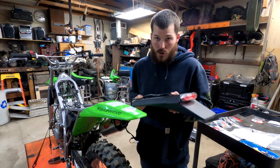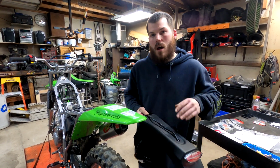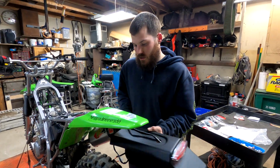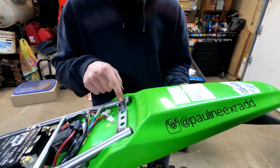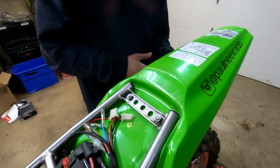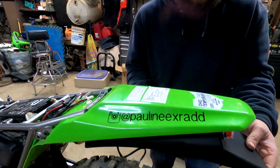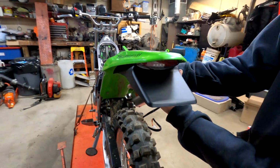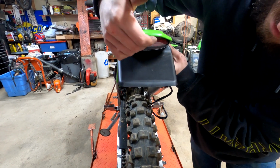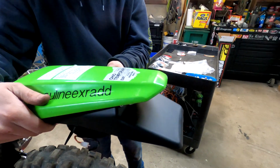But regardless, we're gonna have to drill holes in this because we're gonna have to figure out a way to mount it here. So there's a couple different ways I was thinking about mounting this taillight. The first one is uglier than the second, which is still not too great, but it is what it is. Tucked up underneath, right under where the back of your seat is, there's two mounting holes already built in for the fender that goes into the subframe. So what I think I'm going to do is use the very back portion of this to tap into that. If I do that back here, it creates a hidden, integrated light look. I would just butt this up as far up into that notch as possible. And then this is kind of the look we would get, something along this line here, right?